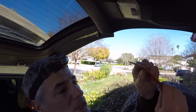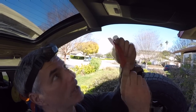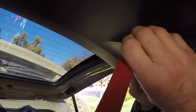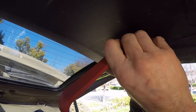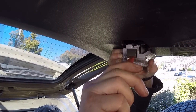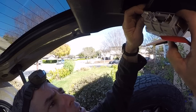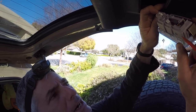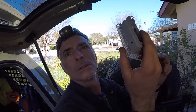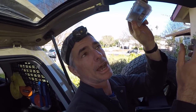I'm going to use this skinny plastic tool that's part of a trim removal tool set — you can also use a thin screwdriver. There's a metal clip behind here, and you're just pushing in to compress the clip and then pull down. This is what you're getting on to push in so you can pop this out. Now we have to disconnect the electrical connector — it's got a little push tab right here. Push it in and pull back. We have to do the same with the other side, mirroring the driver's side.